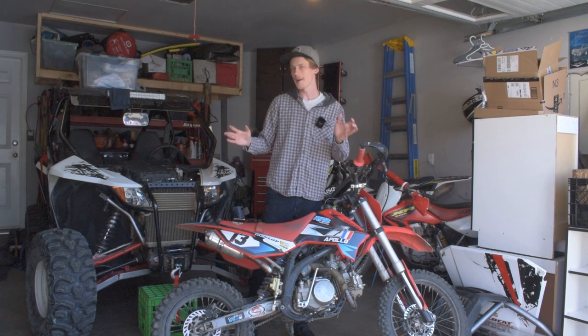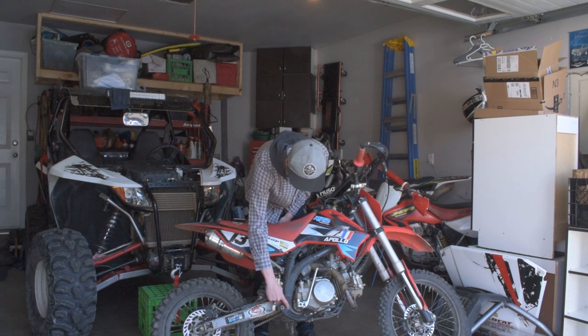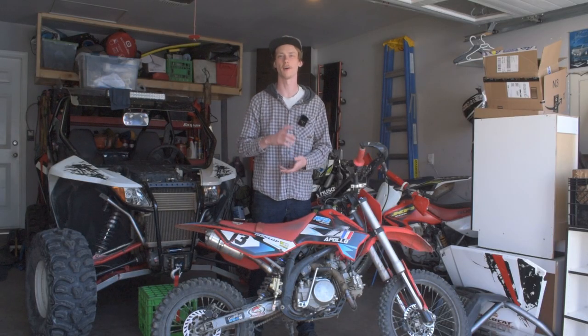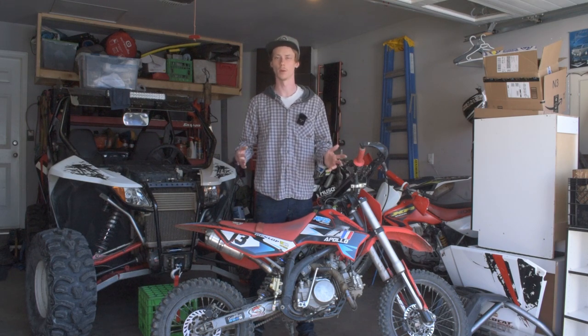Back onto the rear brake problems — when you hit this rear brake arm, the ear on the frame where the welds are is likely to crack. Mine cracked and the actual ear that holds the brake lever cracked right off the frame. I had to re-weld that back onto the bike. The welds on these bikes are pretty poor.